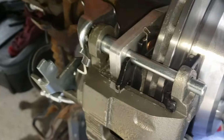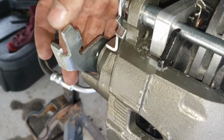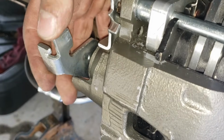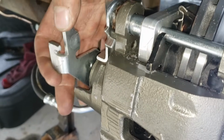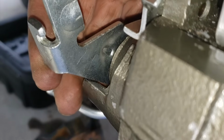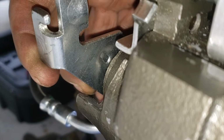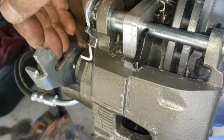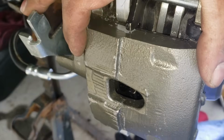So I just finished adjusting the parking brake lever. I'm not going to go over how to adjust this because there's a bunch of different ways to do it, and it's a bit of a pain in the butt to get it just right. More often than not from the factory, they will come pre-adjusted already, so you won't have to mess with this. When you actuate the lever, it shouldn't travel more than 1/4 inch before the brake pads actually grab onto the rotor. In case you do need to adjust yours, I'll post a link in the description to someone else's video.